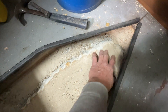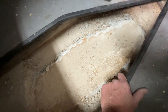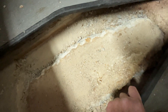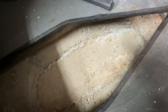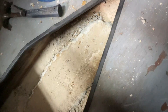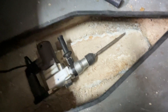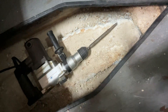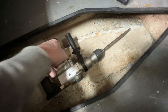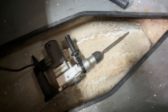You can see where it cracked right here too, and this part is higher than back here. I'm going to chip this out and clean it out and just re-pour it — I'm not going to just put carpet over it and hide it. I'm using a hammer and a chisel, but I'm also getting ready to use my little hammer drill on hammer action only. I won't use that around the edges because I'd be afraid I'd punch a hole right through the fiberglass — only using it here in the center to knock this heavy part down.